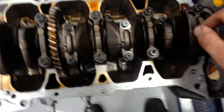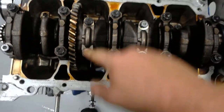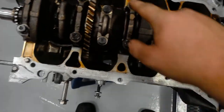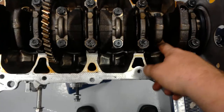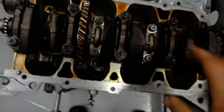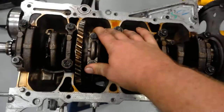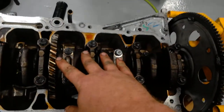There is a specific torque pattern for this and it's pretty much about the same, just doing some X's. We go here, to here, to here, to here, back over to here, back over to this one and then this one. It says to have it down at 19 pounds of torque and we're going to do that in two stages — one stage at 10 pounds and the next stage add an extra 9 pounds to get it down to 19 pounds.